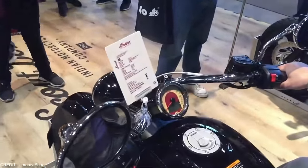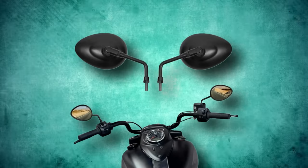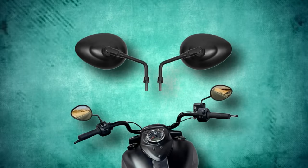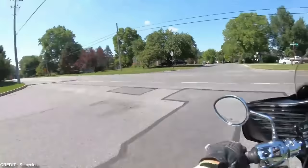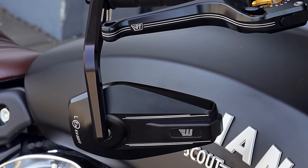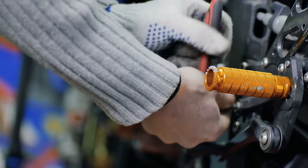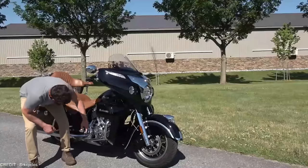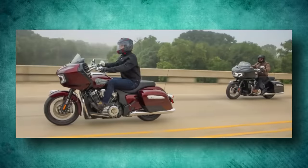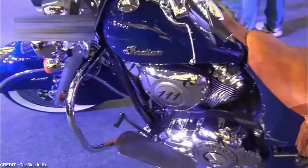Another pretty common complaint with this bike is that the mirrors don't stay tight. Indian motorcycle mirrors are unique in that they don't require fasteners to secure them to the handlebar stems. These are instead sliding adjustment nuts that come loose due to vibration. The mirror stem on Indian motorcycles is secured with a nut that is tightened around the stem itself. Once you position the mirror where you want it to be, you may secure it by tightening the bolt. The mirror stem might become dislodged due to engine and wind vibrations, rattling back and forth. A loose Indian motorbike mirror can become a serious safety issue at highway speeds, flapping back and forth and even hanging upside down.